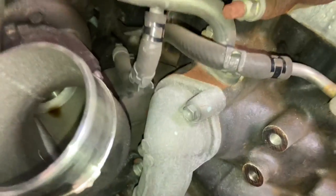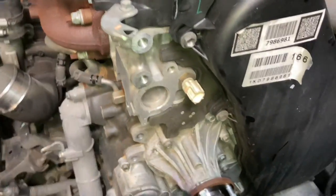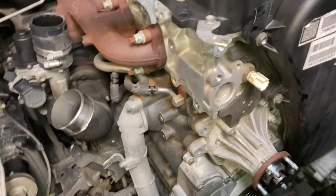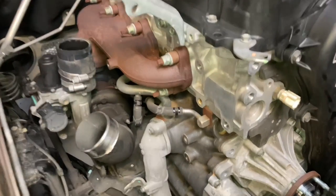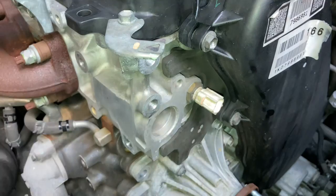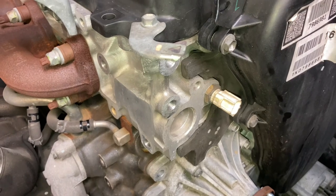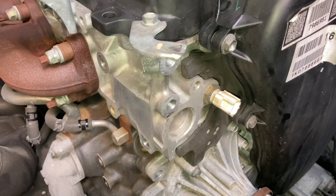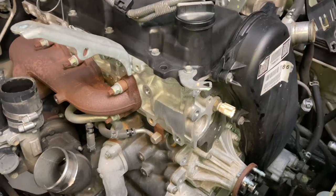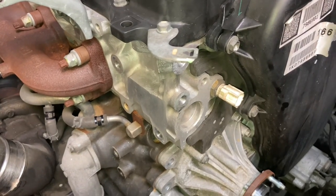Access to the thermostat is good, but we don't see problems with thermostats on the 1KD, so no need to go in and replace that. They say 82 degrees on them, but by the time the coolant gets to the temperature sensor, 83 is what we see at the scan tool. That's the difference for people that want to be technical — some people like to argue about 82 versus 83. So just to be clear: 83 at idle is the temperature from that sensor. In average 20-degree temperatures you'll see it idling at 83, but don't worry about the thermostat too much.